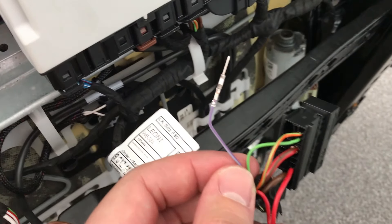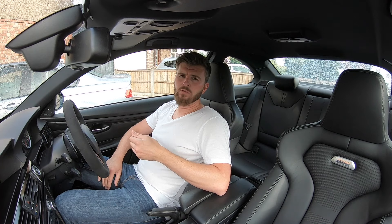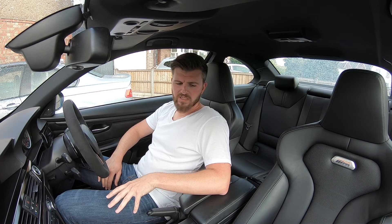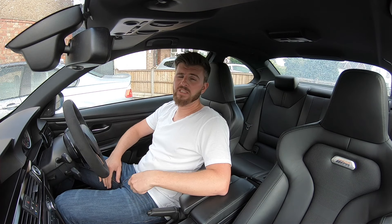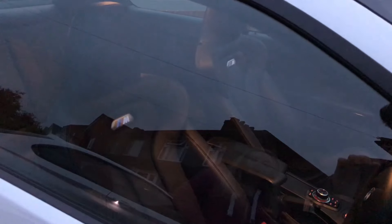With the M4 seats on the bench, take the purple cable on the M4 seat, snip the small pin plug on there, and use an adapter or quick-fix connection because you're not going to be able to use the original plug. The E9 series seat doesn't have a lighting loom as standard because the E9 seats don't light up, but it's a really nice feature. I wired it into the rear puddle lighting so that when you lock or unlock the car, the seats will slowly light up and then turn off as you lock. You can't use the main harness plug for that.